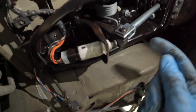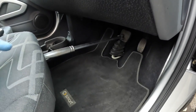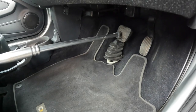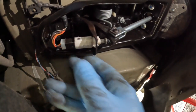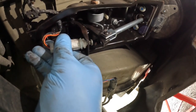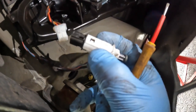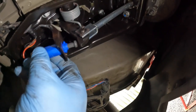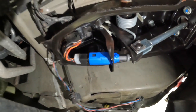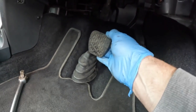When the brake pedal is not being pressed, pressure is on the switch, so I need to apply some pressure to the brake pedal so we can remove the switch. I've just placed a breaker bar between the seat and the pedal to apply pressure to it. You'll now see there is a clearance between this linkage and the switch, so it's no longer under any tension — and now it is just a case of push and twist, and it's removed. I disconnect this electrical connection here — it's very tight and quite hard to remove. Then the switch is pushed back in and twisted fully home — there was a little click there. Now release the brake pedal, and it's just pulled back as far as we can, which sets the new switch.